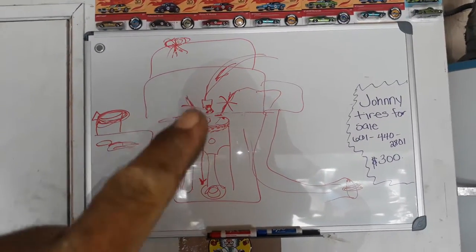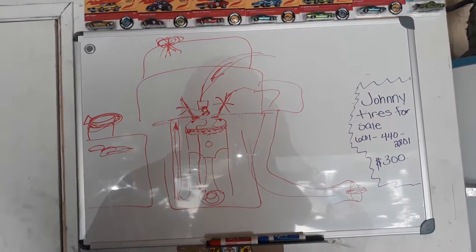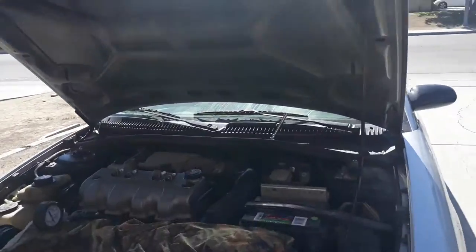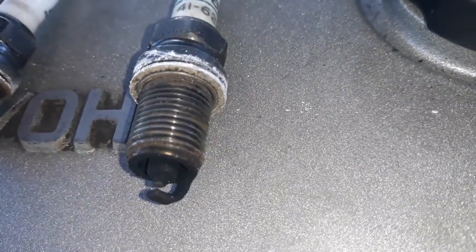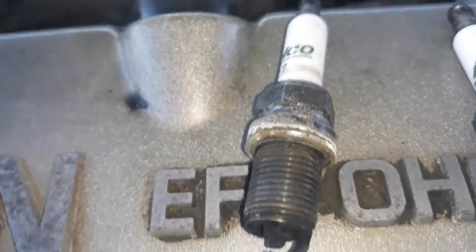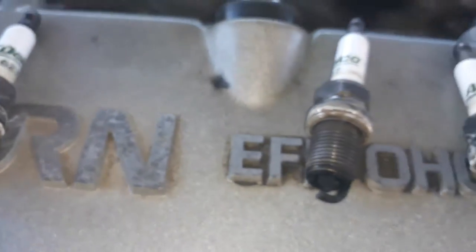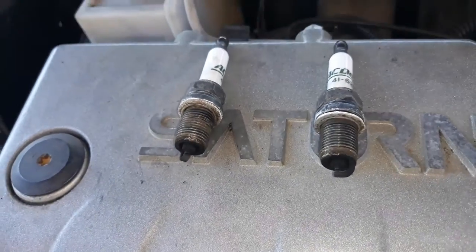We just went over how this stuff works — the blow-by out the oil cap, the tailpipe, the throttle body, and the radiator. What I went ahead and did is I removed all your plugs, and I want you to take a look at what your plugs came out looking like. The plugs have all that black dirty soot on them. Hopefully you can see that — this one's the worst one, cylinder 3. See how bad that looks. This is cylinder 2 and then cylinder 1. I'm going to put up some diagrams about what colors you see on spark plugs and what it means.